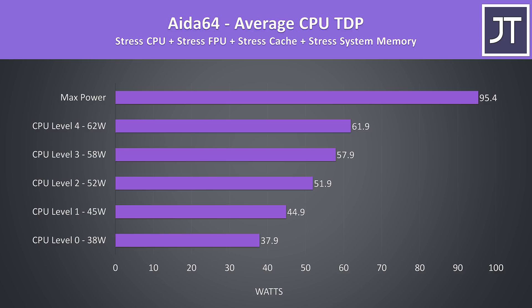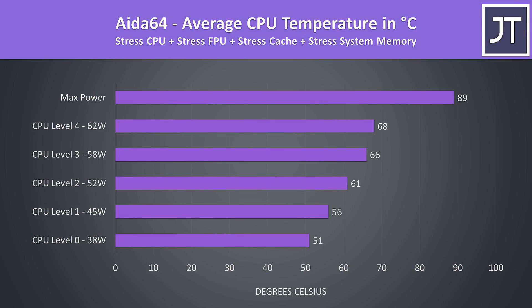By boosting the power limit, the TDP of the processor is reported as running at 95 watts in this workload, which is a fair bit higher compared to the other default settings, but extra performance is definitely obtainable. More power equals more heat, however in this case we're still just 1 degree off thermal throttling in this workload — granted I did have the fans maxed out here.